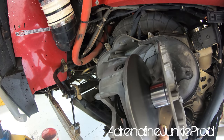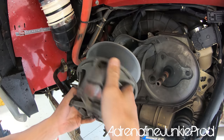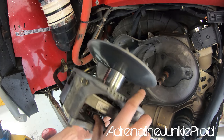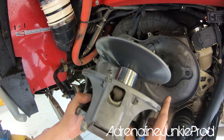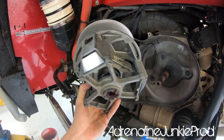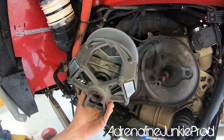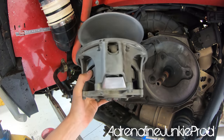I'd say this one came off really well in comparison to some other experiences I've had. Now we'll get the clutches wiped down, blow everything out with compressed air to remove all the belt debris and dust, then set them up on the table to dig in, install the weights, and soup it all up.